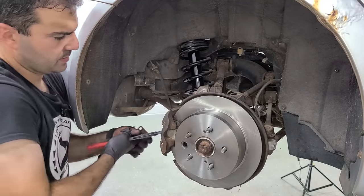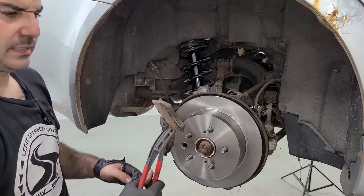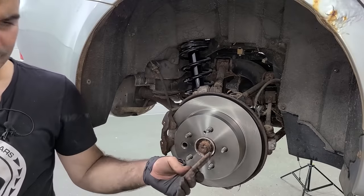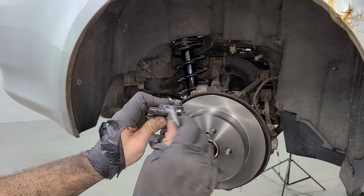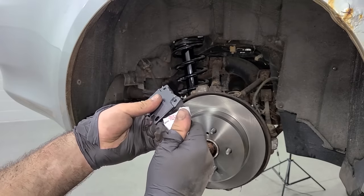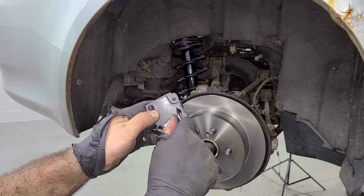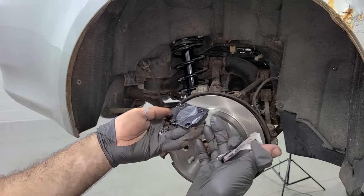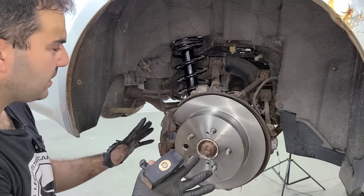Brake pad number one. All right, brake pad number two. See, these really weren't that bad at all, but that's okay. We got brand new rotors, we gotta do new pads. You guys have seen me do brakes a million times, but I'm gonna get some of the supplied brake goop on the pad here on the sides. A little bit there too, where the piston contacts the pad, and rest in peace, my gloves. All right, I'll put the hardware on, and this is all done, one out of four.